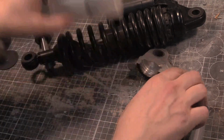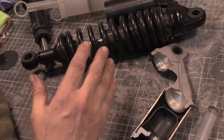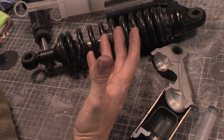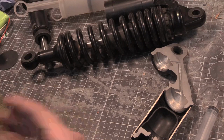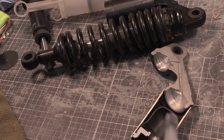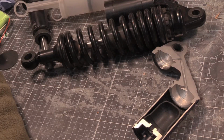So with this system, you'll say, oh, the spring does the suspension, the oil does the damping, but that isn't quite true, because the oil that you're displacing acts kind of like a spring, in a way, because it regulates how something is being compressed, and then the flow back does the same thing. So you could call the oil reservoir a slow spring. Any air in the system, like in this bladder, is like the air gap above the oil in your forks. It is an air spring.